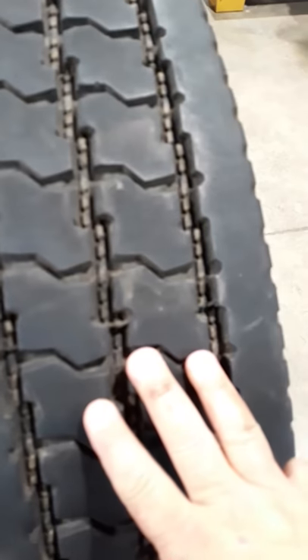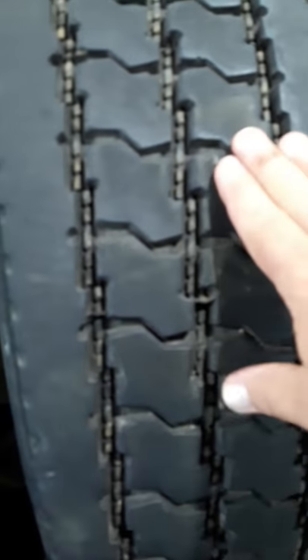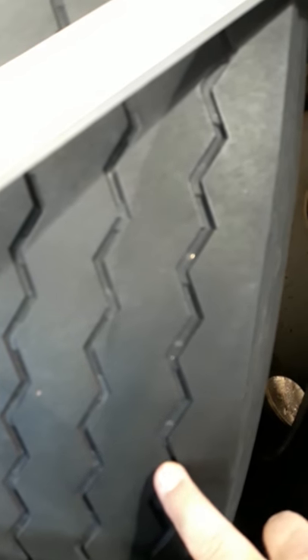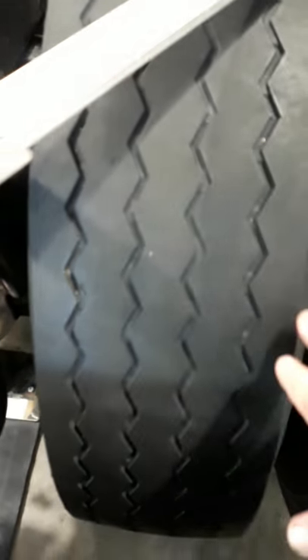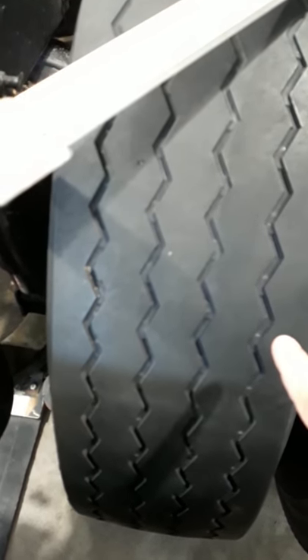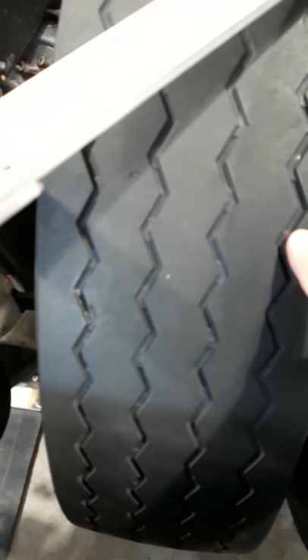When we get to the passenger's side on the back, we can see we have a lug-type tread here, which is considered a drive axle or drive tire. This other tire is a steer tire — it doesn't have lugs and should only be on the front axle, or possibly a trailer. So those two should definitely not be on the same axle, and especially not side-by-side on the same dual.